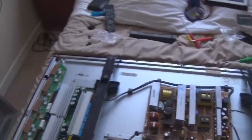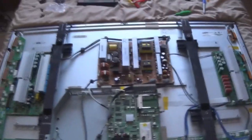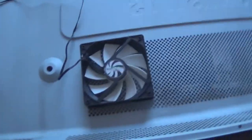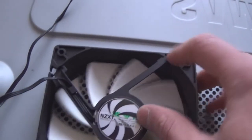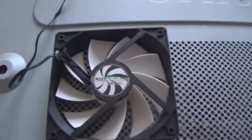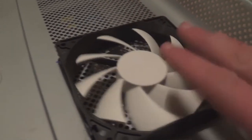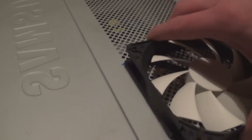So now that means I'm not going to have to faff about with the sustain voltages. I'm going to see about adding some fans into this because they get pretty damn hot. I've seen the TV powers up and the panel is all good. I'm going to add a 120mm fan to this and superglue it to the frame in the back case. I don't have any fan screws, but I'm going to run this at 7 volts so it should move a decent amount of air. So I've got the fan superglued in place - used a fair bit of superglue and that is not going anywhere.